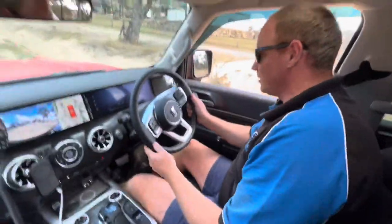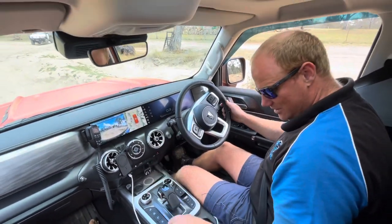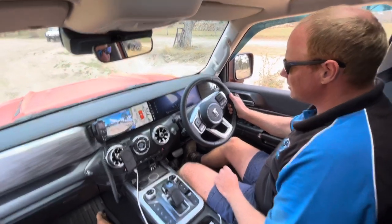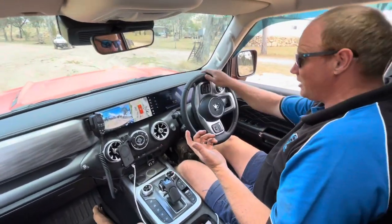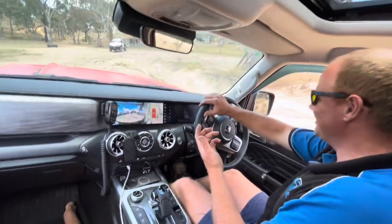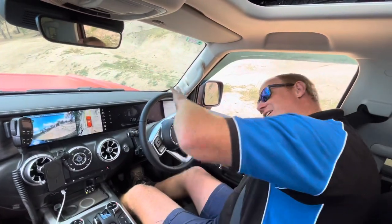Okay, so we've flexed out again. Everything's still on the ground. The car is 100% stable. Doesn't feel dangerous or anything, but we'll chuck on that rear locker again. See, it picks up nearly straight away. There's no delay in the locker. Wheels are off the ground. Now it thinks there's a car beside us because we're leaning right over again.